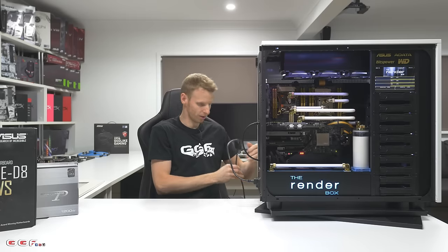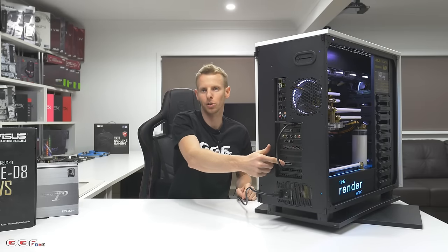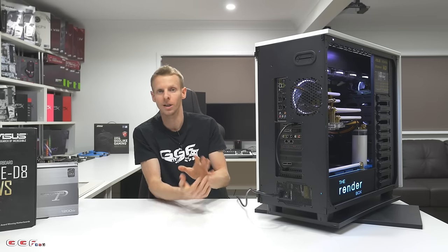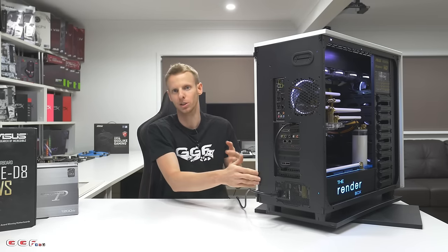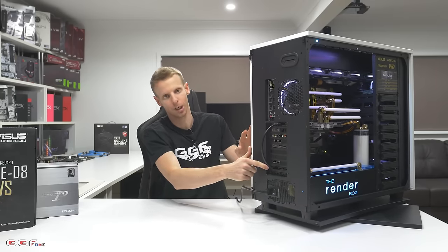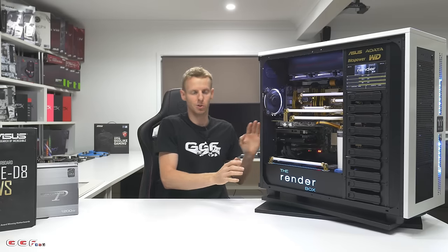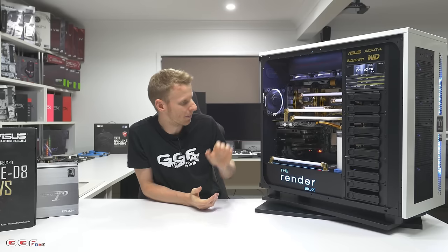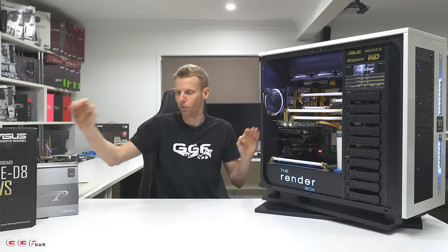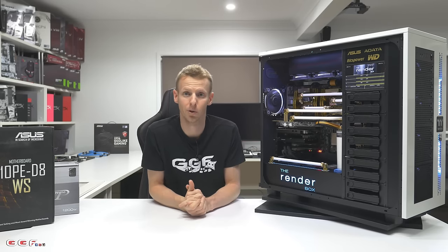I'll get a back shot of the system. You can see there are two ports here — one goes into the RAID card and shoots out an external mini-SAS cable. I do have an LSI storage shelf that takes 12 hard drives, and I've got that full as well — I don't always have that on, but it gives me an extra 12 hard drives connected to the system. Then you've got the sound card, video card, and the HDMI from the little screen in the front area connecting straight into the video card. Thanks to all the sponsors for supporting this build — ADATA was the main sponsor for the new SSDs. Thanks for watching, hope you enjoyed the video, and stay tuned for more.